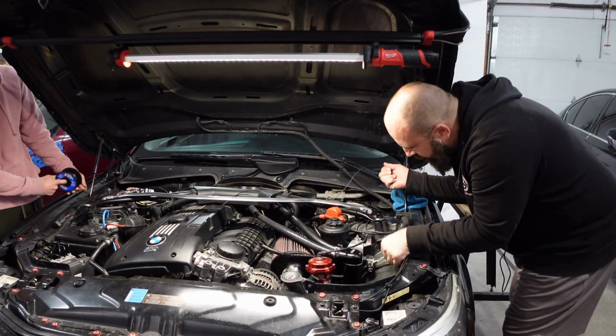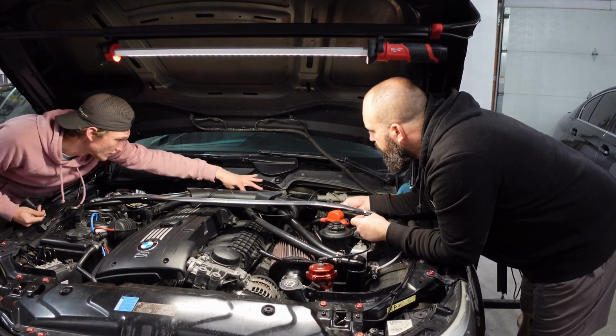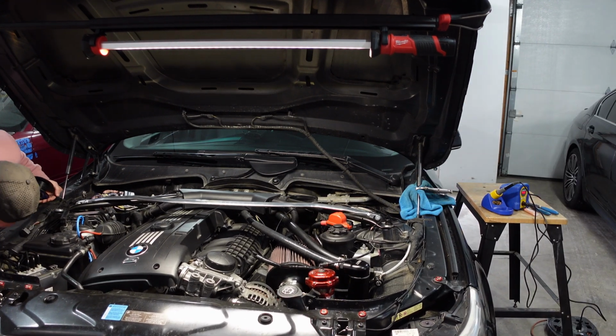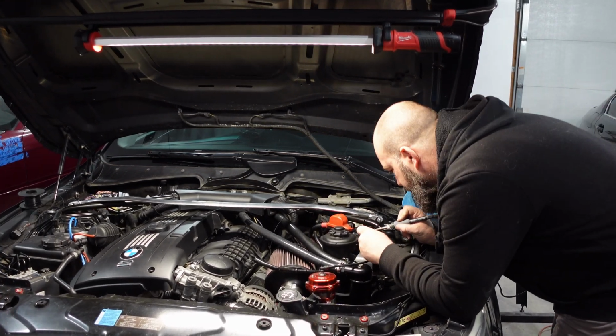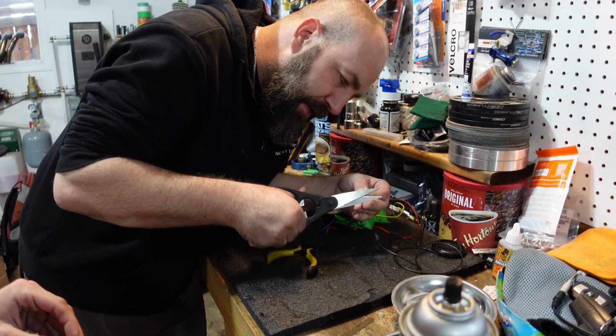Afterwards, we're gonna start by soldering the wires. Now, the one soldered wire will actually go over to the JB4 box to connect to the JB4 with a separate solenoid. The second wire will actually just be a chassis ground. You don't need to worry about which wire goes where, just because it ends up completing a circuit.